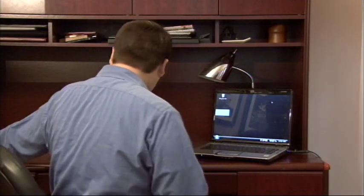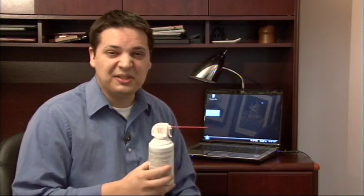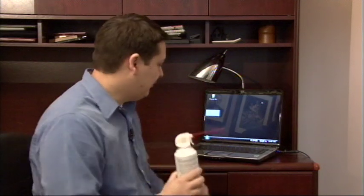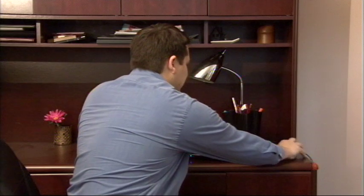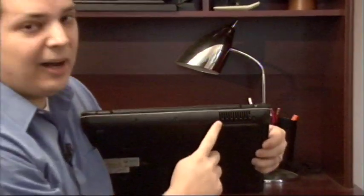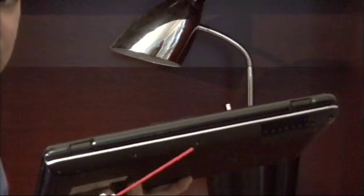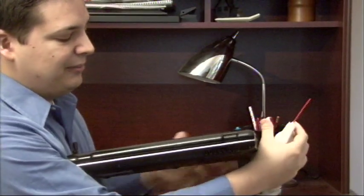What I'm going to show you is to take a can of air duster. You can find this at basically any computer store — office stores sell this as well. What you're going to do is take your laptop and find the exhaust area. It's usually on the back or the bottom. In this case it's right here on the back of my laptop. I'm going to take this compressed air — it has a little straw that directs the air to where you'd like to blow it.